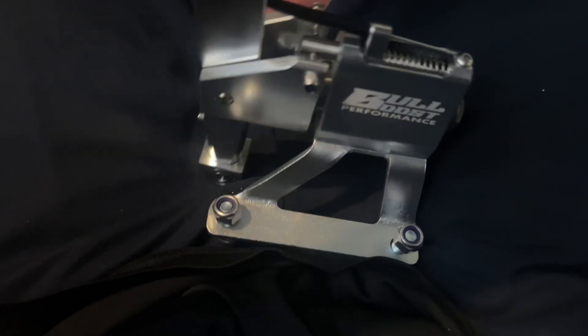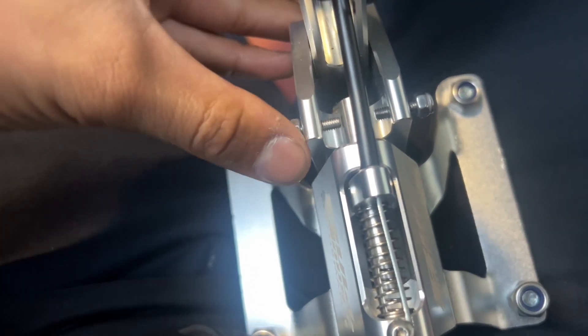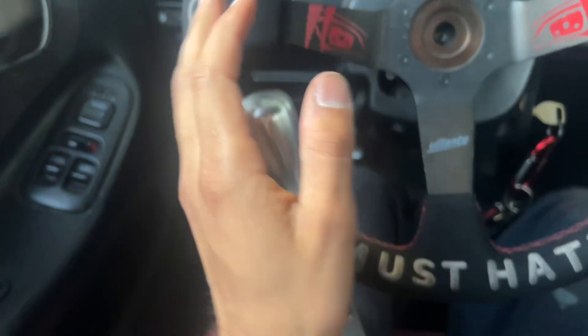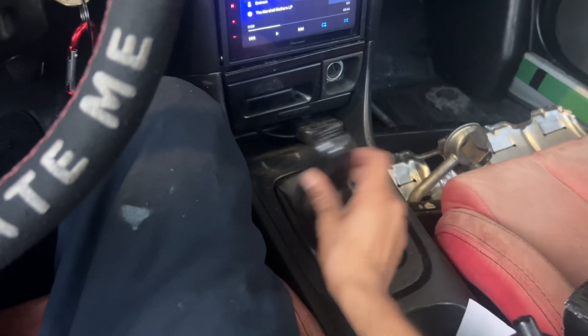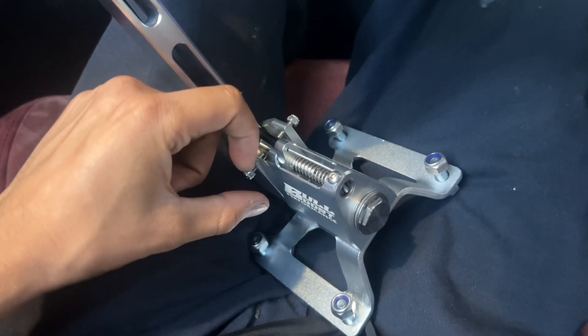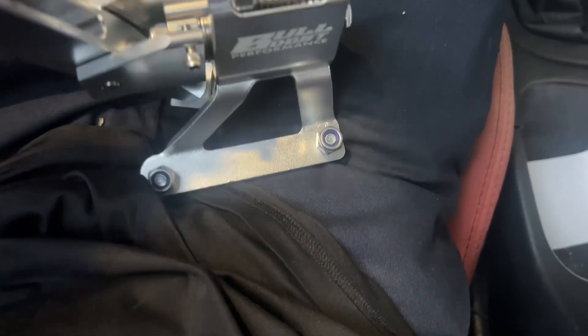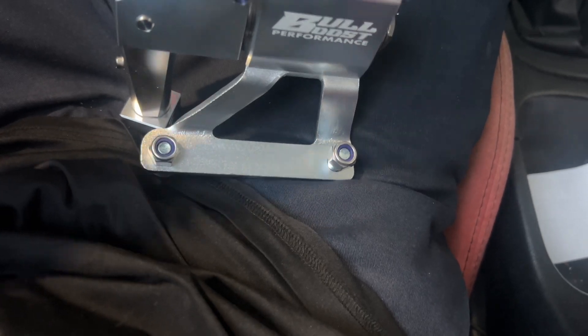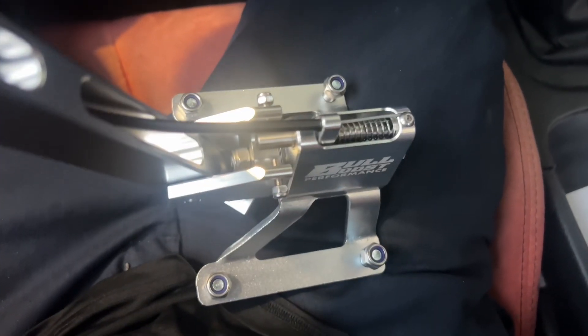They give you the hardware for the four bolts. Also, if you have like a 1-through-5 shift pattern, you see these screws — they'll tend to unthread and you'll get more of a tight shifter throw from side to side. It's kind of like having a side-to-side plate that's not necessary. Wherever your first is, wherever your fifth is, you place that there, use the locking nut, keep it in place. And for those who like to money shift — say going from third to fourth or second — you can tighten this so the lever goes in.